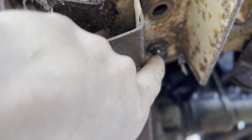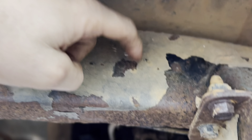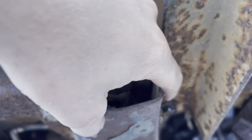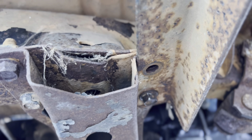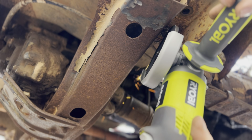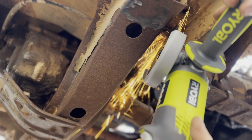Well it's not fun because here's the chassis rail, and see how this has got the nut on the back out here and it's exposed? In here there is a nut where you can't put a spanner on — the top is a nut and obviously the weld's broken so it just spins.